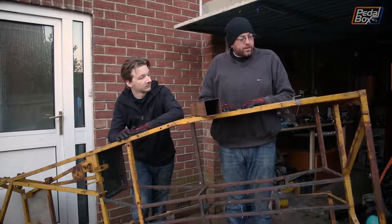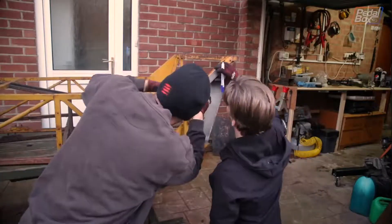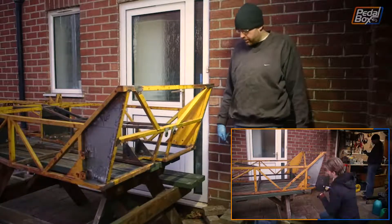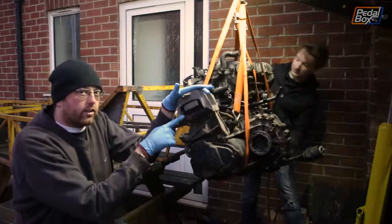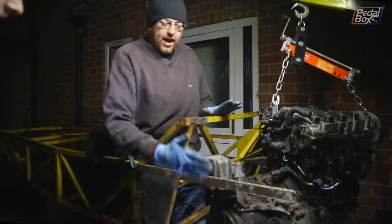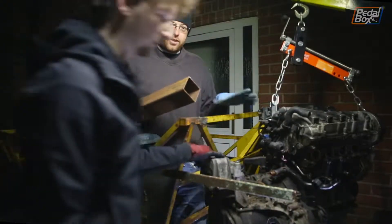If we're going to do anything, we need to flip this over onto something. So we've taken the angles and shuffled everything back across — there wasn't a great deal of point in levelling out the table. But if we bring the engine up to this now, we can start working out much better how high everything needs to be, because the two mounts are at different heights. So we actually need to work on this one more than that one, which might have been an error — we'll see. This clearly is not at the right angle for how we're going to mount it, so we're going to have to put this back down, shimmy it around a bit, and then pick it back up again. With the chassis leg coming down the back of here, the inside is going to be the furthest out part of the chassis rail. So essentially the outside edge of this is going to run along the inside edge of there. Now we can lift the engine, position it, and see where it's actually going to end up.